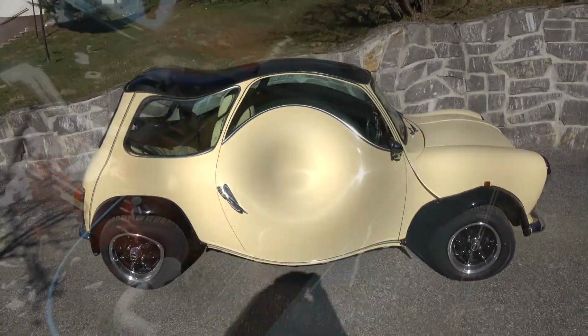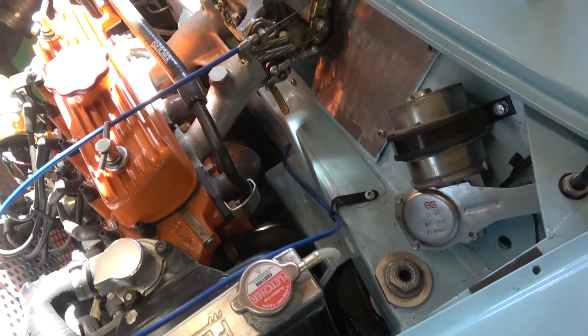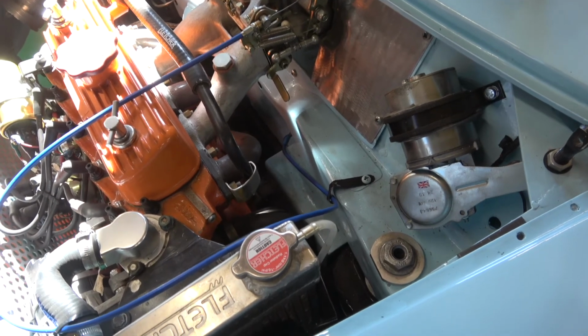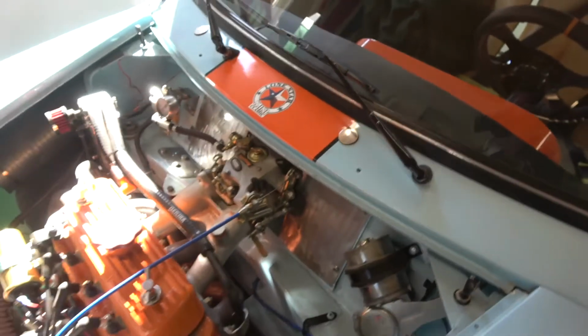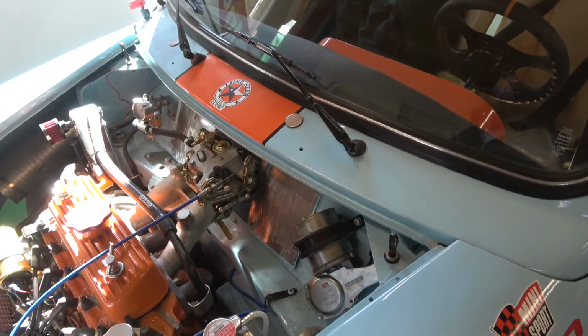Alright. So what I'm going to do is I'll take that inlet manifold off and get to the exhaust manifold, and then we're going to wrap it. We've got some special wrap to put on it and put this gold across the back here, and then get that electric fan down in there so you can see it, and put that on a switch. So I have to take the part of the exhaust off to do that.